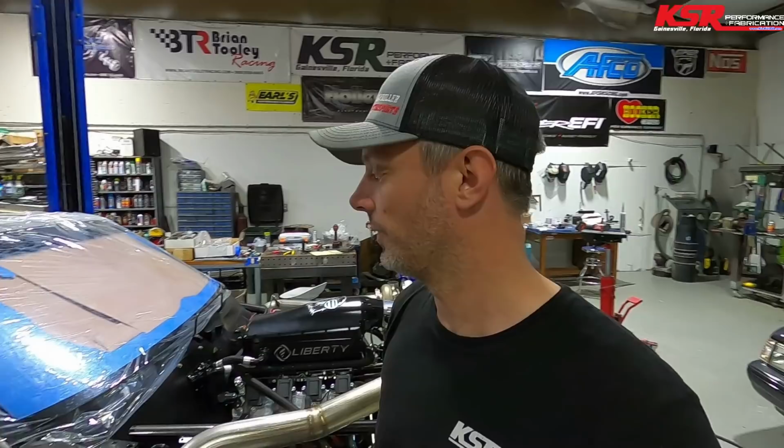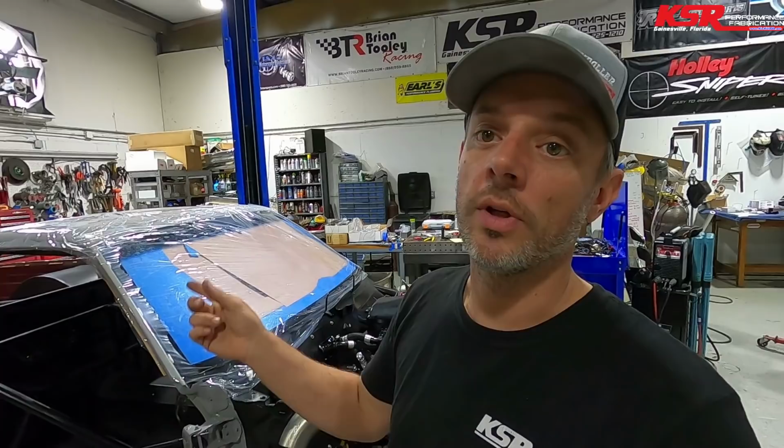Well, everybody, our race got rained out of the 352 shootout. So instead of that video of us racing soccer mom in the lawn dart, we're gonna be continuing on mullet. So I'm gonna jump in, cut out the stuff we need to cut out. CJ's already been making some of the gussets that I've got to weld in. Goal is to try and get the bars in today, hopefully come in tomorrow morning or maybe later today, paint everything. And then by Monday, we're back reinstalled.